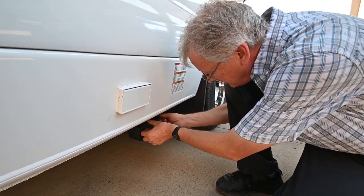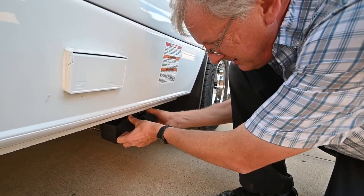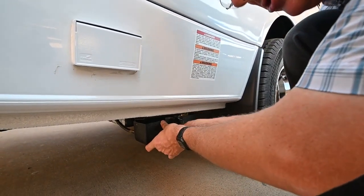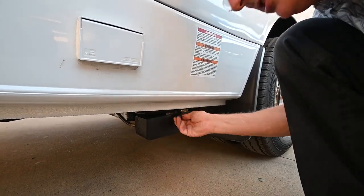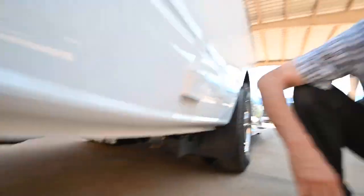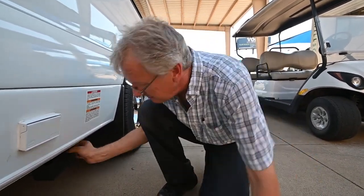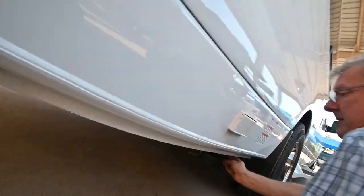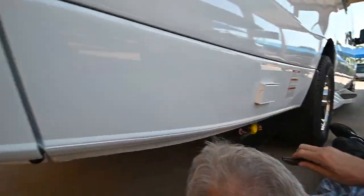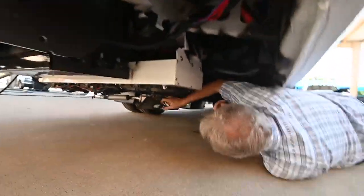When traveling you may not need the propane on unless you're running your Espar heater or water heater down the road. You can also turn it off in storage for safety. If you need the generator going down the road, it's located right here - it's also an LP generator, so you'll need that propane switch on to run it. I'm going to show you how to take the door off and check the oil level - you've got to want to get under here. Take the door off and I have a dipstick right over here on the left - unscrew it, pop out the dipstick, and check the oil.